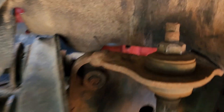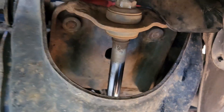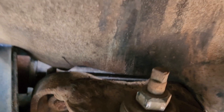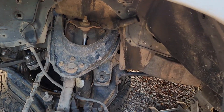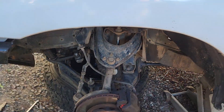It turns out that top welded mount can't come off - it's welded to the chassis in a couple of spots. Way too much effort to pull it off. I mean those welds are pretty solid, massive welds. Let's just hope they're penetrating well. Worst case scenario, if that top mount did smack off, it'd be the same as losing a shock - it wouldn't actually be too bad.